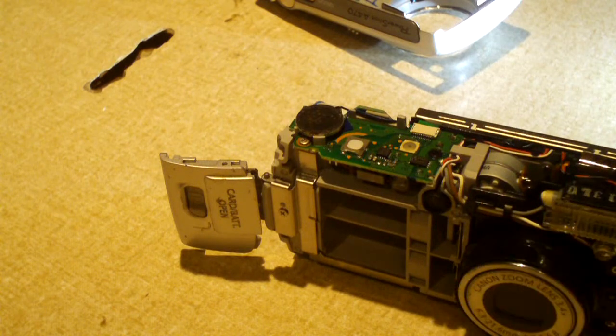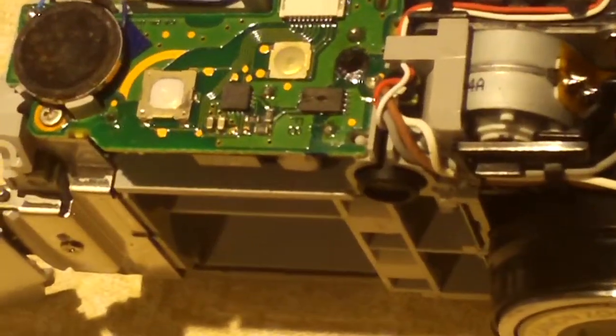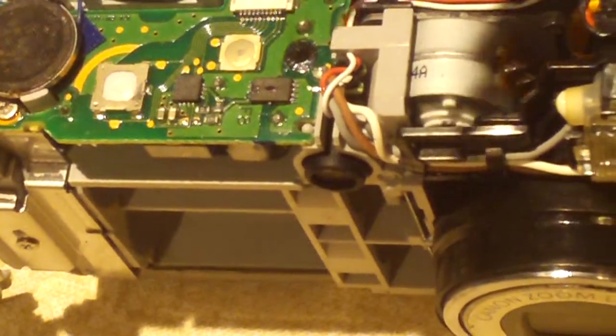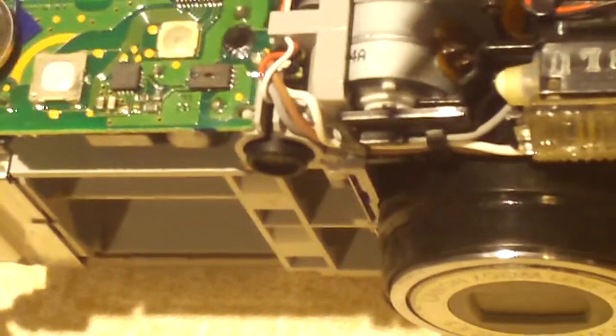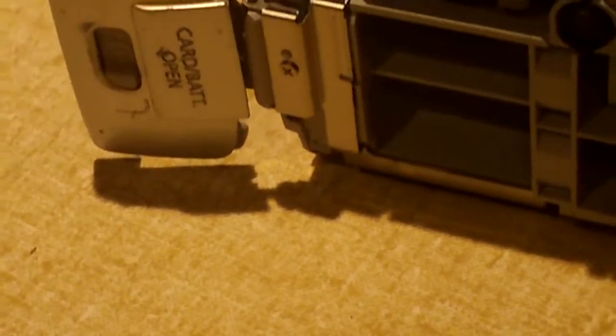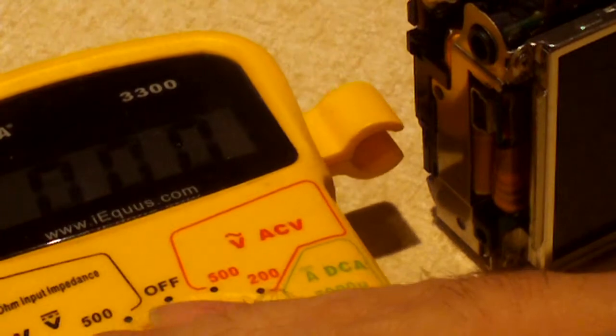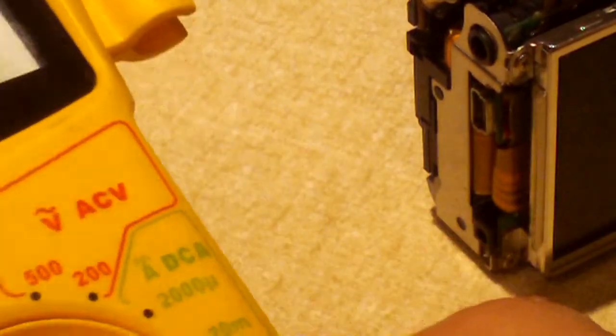I want you to take a look at this meter. If you look carefully, here and here are terminals. Now the black spot is actually, I think, the positive of the capacitor. But I can actually branch over and touch this next terminal and I get a connection. I want you guys to look at the voltage that's stored in this capacitor. Now I'm assuming this is probably a 300 something volt flash cap. I'm going to prop this meter up on something so you can see a little better.